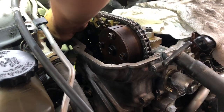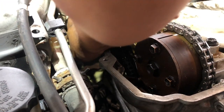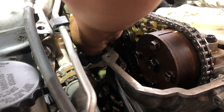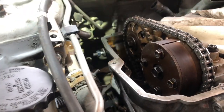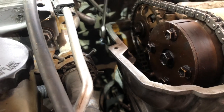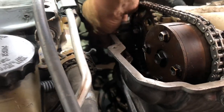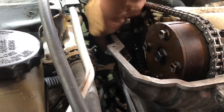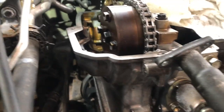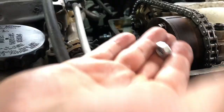I had to purchase two nuts from the hardware store. I'm using these two nuts and tying them up together in order to take the stud out. That stud is the one with the little shock-looking thing on the belt tensioner. There's no way you can completely take out this cover unless you lift the engine high enough to clear that stud.